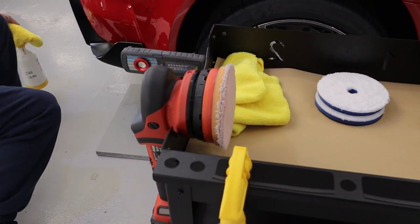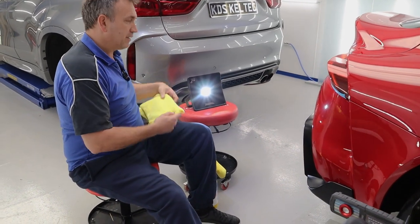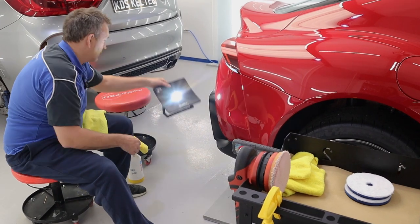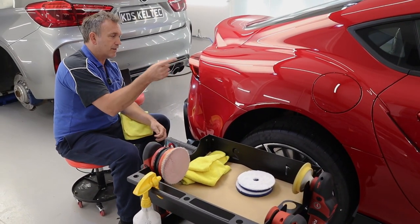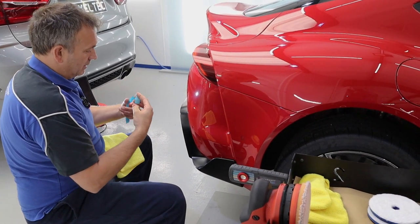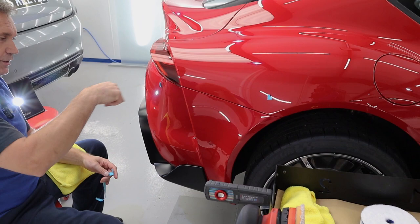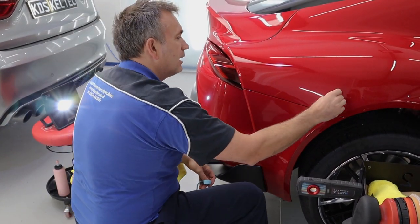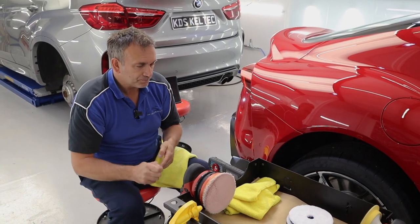So hopefully that makes sense. But what if we had the light too close? We had the wrong lighting in the building, we didn't understand. We didn't lift the car up to the right height. If the light was down there, you wouldn't have seen that defect. So you see now why I scan the car — my staff scanned this car for a long, long time to make sure they see every little defect. You've already seen the magic marker of masking tape — we put that masking tape on defects like that. As you've seen before in Tesla videos, you do a mark there and we can photograph and film it, so it helps us document where the marks are. So when we start the car up here it's upstairs — we've got where to polish, we can take the tape off and polish those areas. For an older car which is heavily swirly, we won't mark so much — we just polish the whole car with a heavy cut everywhere as a two-stage correction.